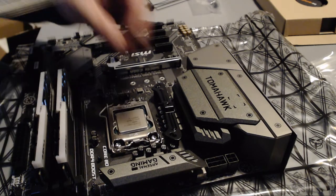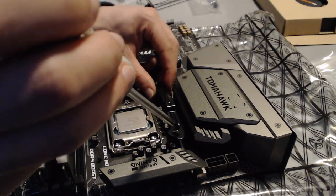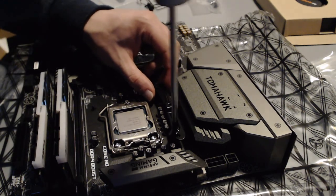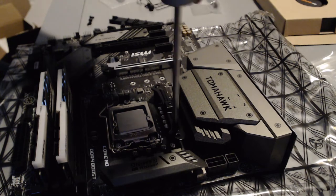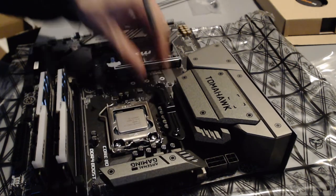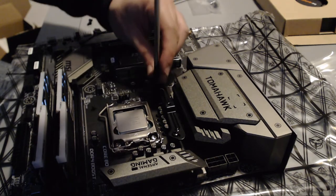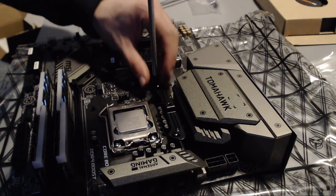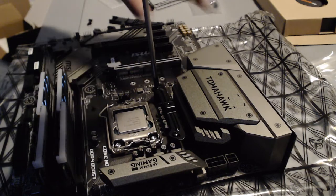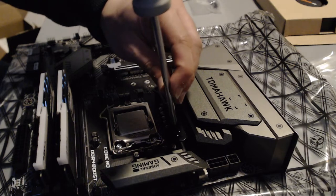So anyway, they should align with the back plate that you have in any case, because otherwise the back plate would not be popping through the motherboard. Again, tighten it and make sure that it is tight but not overly tight. You probably will want to get the two screws in there before starting to tighten, otherwise the plate will start rotating instead of actually getting completely tight. So get them both in there, get them nice and tight.